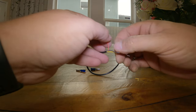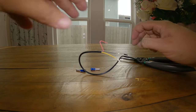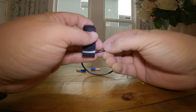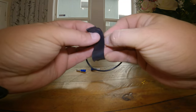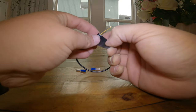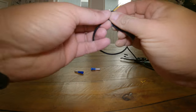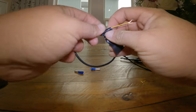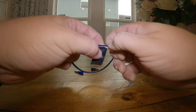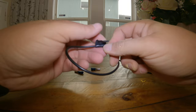I'm going to take the red wire and fold it back. I don't want to cut it off because I might want to use daytime run lights in the future, but for now I'm going to fold it back and tape it up so it's out of the way and not touching anything. This would also be a great place to add shrink wrap tubing — just heat it up a bit to protect the wire and make it look cleaner. I don't have any on hand right now but I'm going to order it and link it in the description.